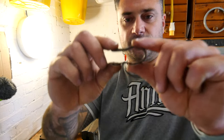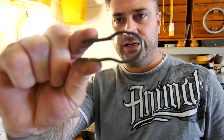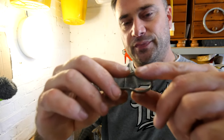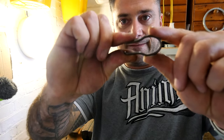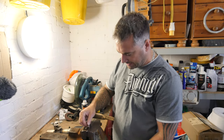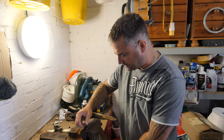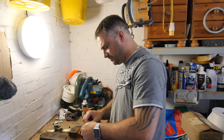So what I've done is I realised that my clip was squashed a bit like that. I've got it under a bit of pressure, so what I've managed to do - you can see that's quite springy. I'm just going to open it up a little bit more than how it is to give it some pressure. So when you clamp the valve down onto the exhaust it's actually going to be like that and then squeezing in to the valve, which should hold everything tight. I've only stretched this the other day to see if it worked and it did, so I just want to put a little bit more force on this to make it extra tight. I don't want to be taking this off every couple of months, so I'm just going to clamp that in the vice.